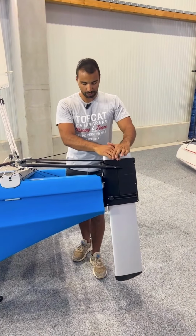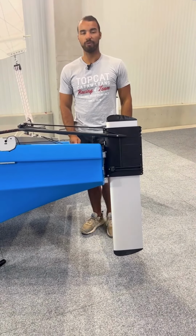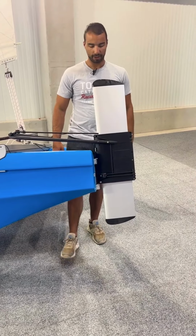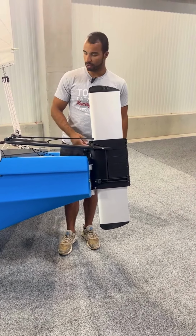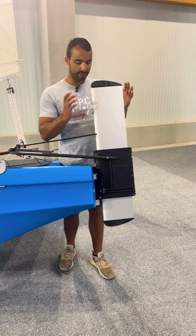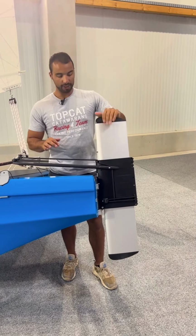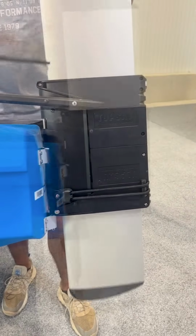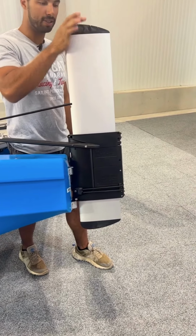We should double check it again, even if we do have ground contact, and ensure that our rudder system really comes up when triggered. Just give it a swift kick and you'll surely see it opens up, rises, all good, nothing more to worry about. Important point now: if you have the rudder blade up, please don't just push it back down, because doing so could potentially cause damage or misalignment. That might cause the rudder blade to come back up again, something we don't want due to steering issues and loss of control. Simply push it forward with your hand, and then close the rudder box again carefully.